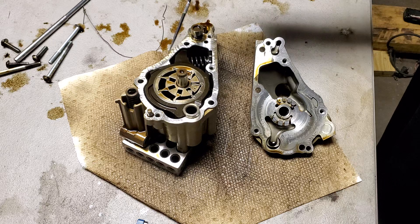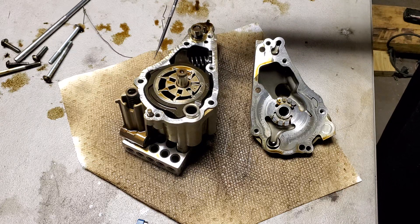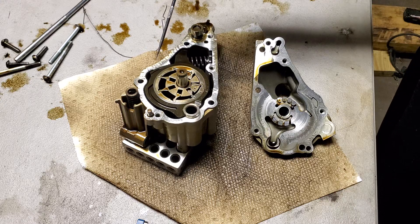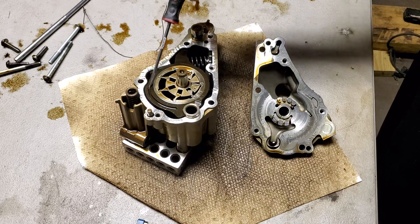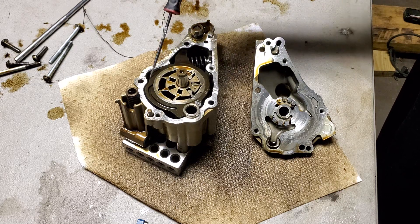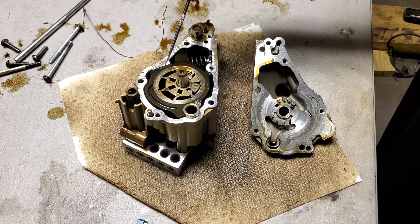So these volumes won't change as much — this is how the oil pressure, or the oil flow rate, is varied. By default, these springs push the pivots into the topmost position where it's most off-center and thus pumping the highest flow rate of oil.